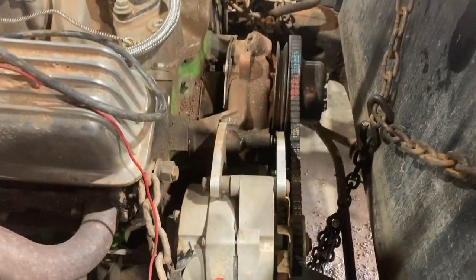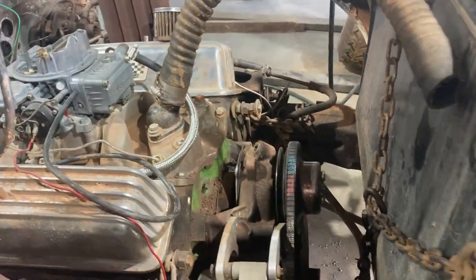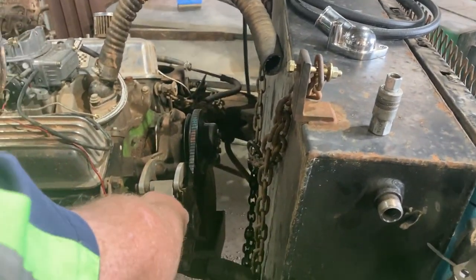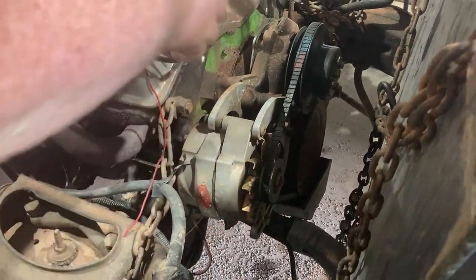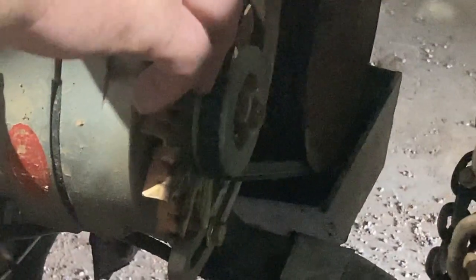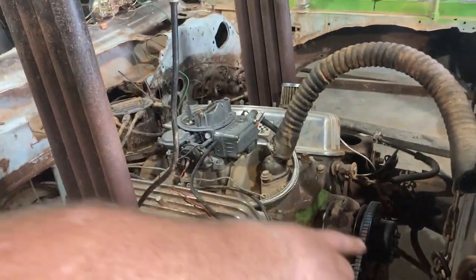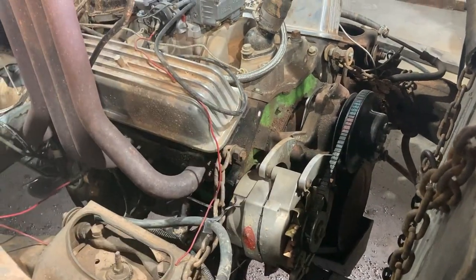Nothing exotic. No. I think that belt alignment will last for what they want to do. We don't have it all on here yet, but there's a pulley protector down the bottom. You can see that. We've got a whole engine cradle that goes up here. That's why all this right here is loose at the moment. It kind of protects the front end. It'll also protect the water pump pulley in case something does happen here. If it comes back on it, it can't go into the pulley system.